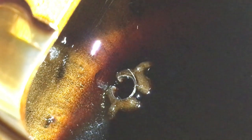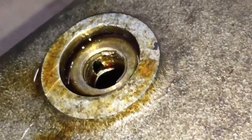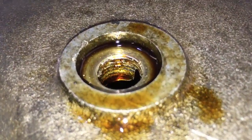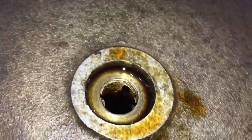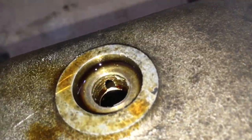Actually, that looks like it could already be a helicoil — I think that is a helicoil. It looks a little bit different to the rest of the casting of the sump. Anyway, that's what we found on the inside of the sump. So we're going to turn the sump over and attempt a Time-Sert repair. You can see the damage inside where the thread is very poor. I don't really know how people over-tighten these — they've got a torque spec of 25 Newton meters. That is terrible thread, so no wonder it wasn't really doing much.